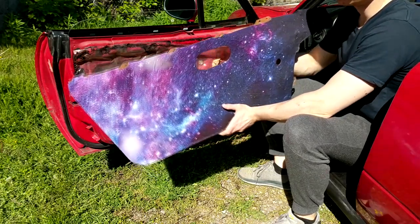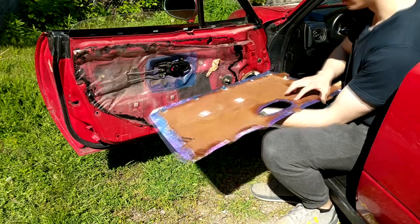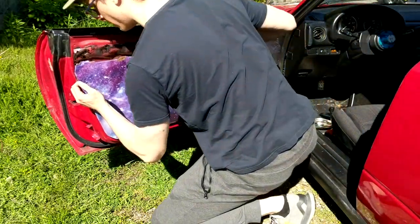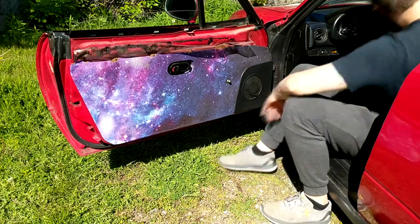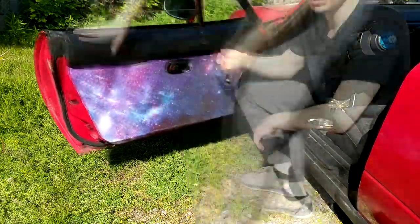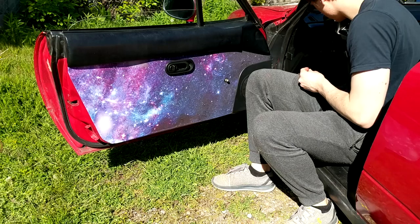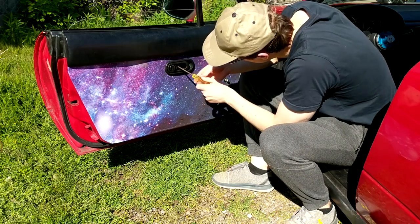Now we're going to install this door card, but before we do that I'm going to puncture two holes — one here and one here — and then hang a rope to basically pull the door closed. Take a shank tool and make a little hole right in the middle. Now the two holes have been made and we're going to pop this back on the car. Next is the door handle trim: lock the door, pull the door open, and slide this on. It won't pop in like all the other pieces, but once it's in place take a Phillips screw — it uses the tiniest one out of everything on this door — and just screw it in.